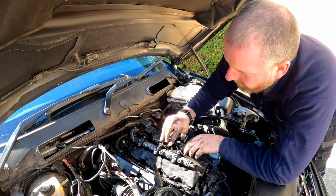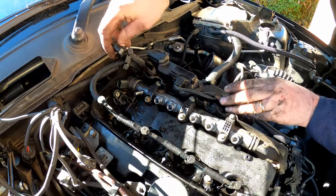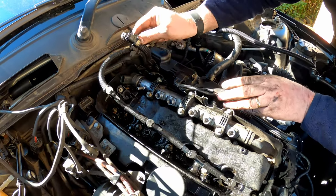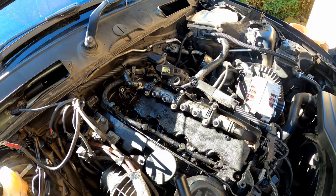Okay, so fuel rail then. 2, 4, 6 bolts holding it in place, and then we've got the return line just up here. Press the button in and it pops off, and as you can see, we already disconnected the electrical connector earlier. So if I get those 6 bolts undone,